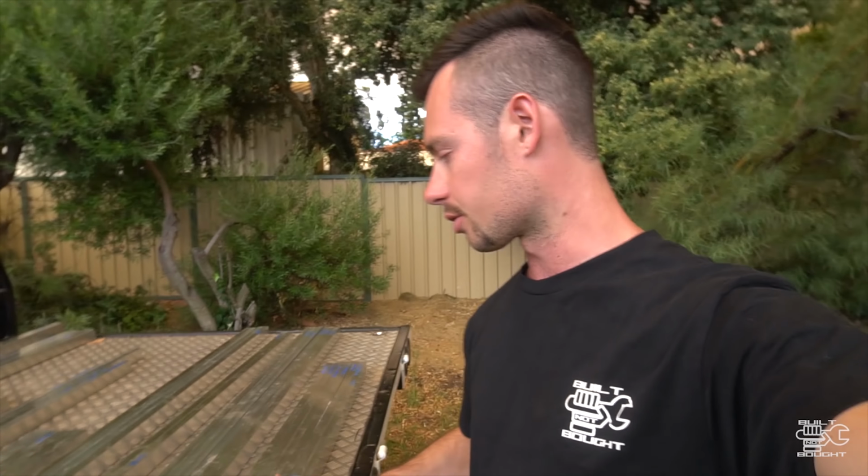Alright guys, now I've just got all the parts back for the canopy, got them all pre-cut from the old man's work. They've got the proper bandsaw on that to cut the alloy. If I was going to use a drop saw here, it would have been hard to keep everything square, and it's not real good for cutting alloy anyway. So got all these pre-cut, so it's all perfect length to the millimeter, all squared up. So what we'll do is knock up the frame, TIG it up, and then send it back to Dad's work to get it skinned. They've got the guillotines and the benders and press, all stuff I can't do here. He'll skin it up and the doors and that, send it to powder coating, then get it back and I'll start hacking it up for all the door locks and that.